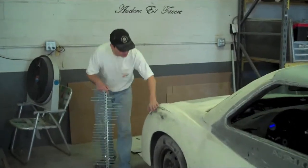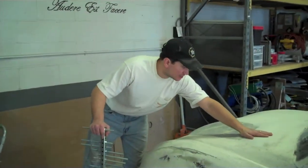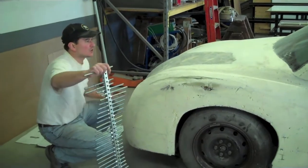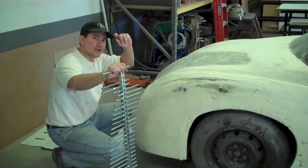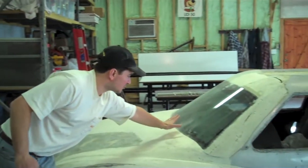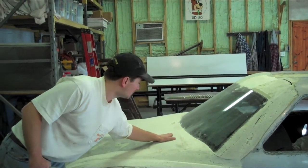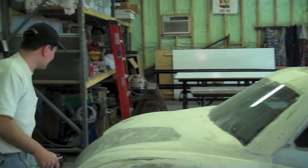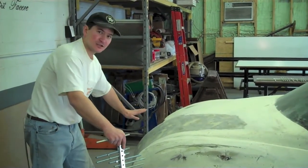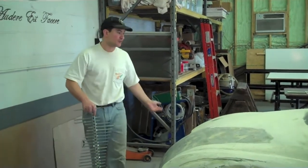We've also been able to clean up the front some. We've been grinding into the old material and reforming the hood in the front of the car. We've raised the back of the hood about two inches, making it more aerodynamic, and we've trimmed a little off the front edge. Originally we had a vacuum that came off the front underneath of the car — we'd lowered the front lip about an inch, and that vacuum pulled air out from underneath while we introduced air into the engine bay at the change of angle between the hood and the windshield. Now instead of creating a vacuum, we're just going to blow it out through the bottom of the car through holes in the flat pan under our electric motor. We were able to reduce frontal area by half a square foot and reduce some more drag.